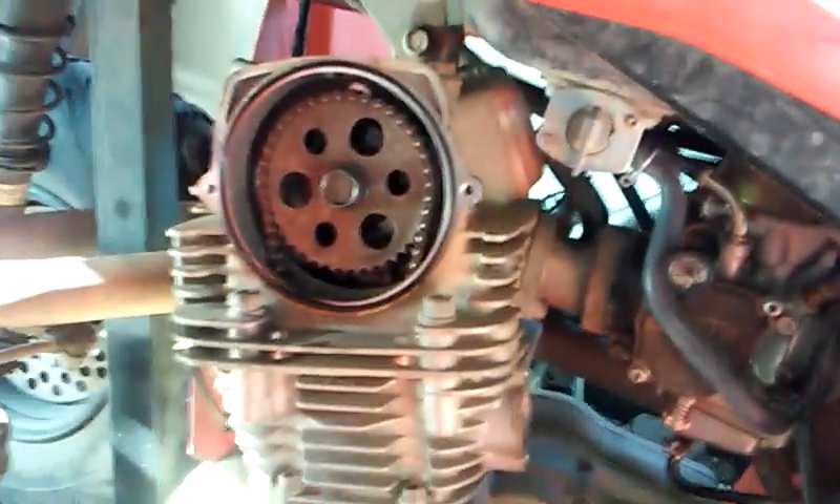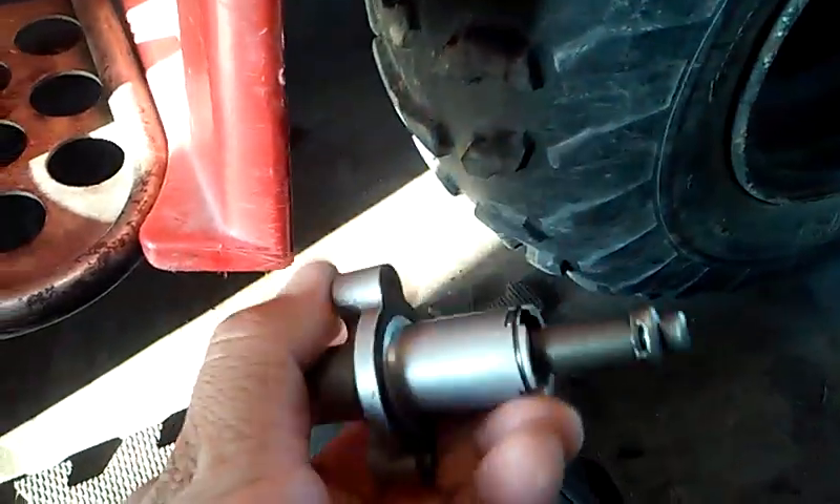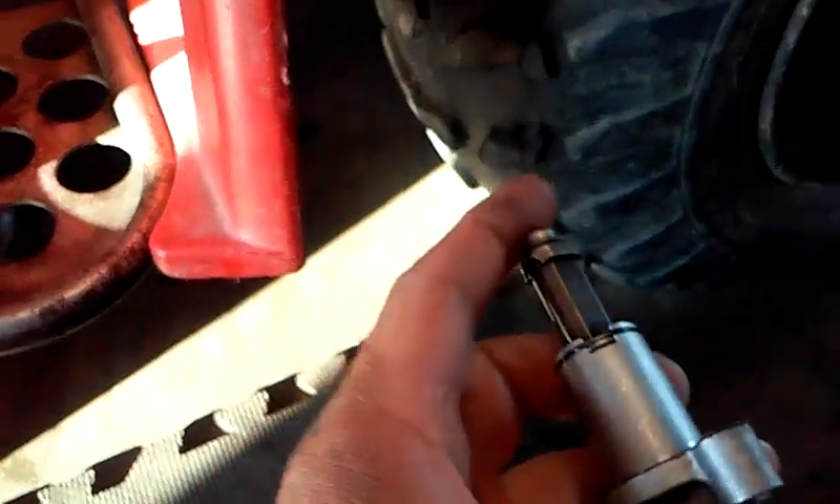There is a valve adjustment on this vehicle, and there's also a timing chain. As we started taking things apart and looking for damage, we found no damage from any clicking noises or anything broken inside. But what we did find was that our timing chain wasn't correct, and when we removed the timing tensioner, we found it was completely extended and no longer keeping proper tension on the timing chain.